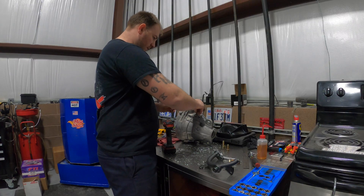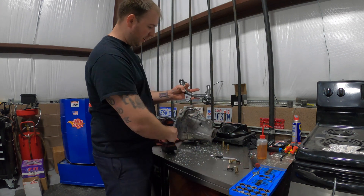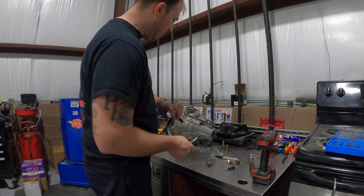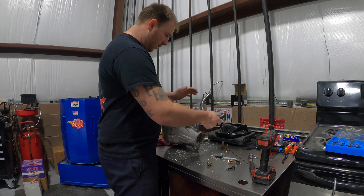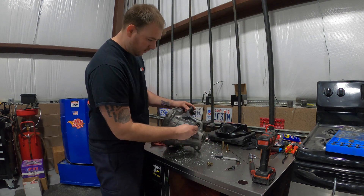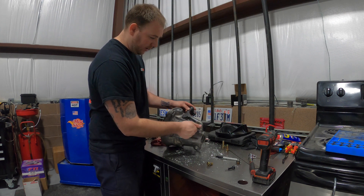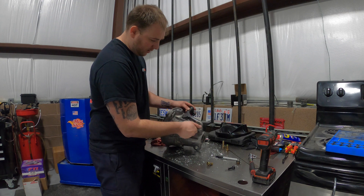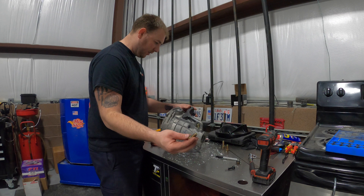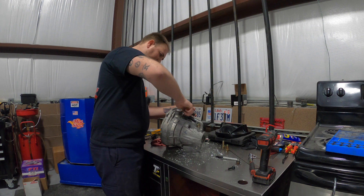We got this threaded — it's good, plenty of case left. The bolt has to go through a half-inch hole, so we just have to punch this hole out a little bigger and then put this bracket on there. So we got the hole punched out to half inch. The bracket mounts up to the 8.8 case like this — this bolt here goes through this hole, no bushings, all solid mount. The way the bracket is made, it fits right in that hole — precision. The washer clamps down on it perfectly and this bolt goes through and catches our threads in the case.